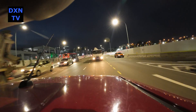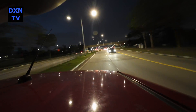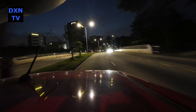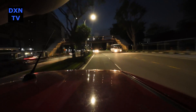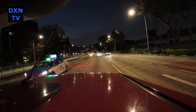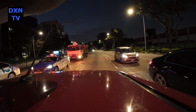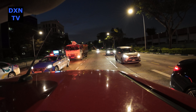While checking out the footage, we want to rant about the hot pixel issues. We've gotten another owner who came back with their own test — she mentioned that there are indeed hot pixels during long shutter exposures with their unit too. Instead of doing a time-lapse, the quickest and simplest test is to use photo mode: set the camera to ISO 100 for the least sensor noise, set a long exposure of about 10 to 30 seconds, cover up the lens, and take a still picture. Let us know if your unit has the problem too.